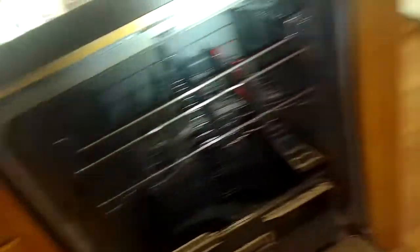We've got those two screws out that are holding it in. I'm going to grab the dishwasher and pull it toward me. This one is kind of stuck by these trim pieces on the side, so I'm going to push them in and then bring the whole dishwasher toward me — just about four inches out from the cabinet. Right about there — that's good.